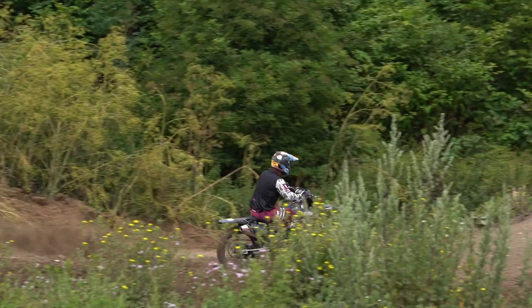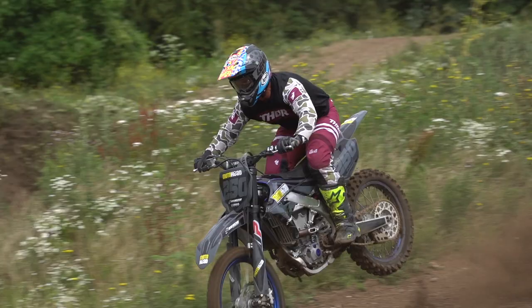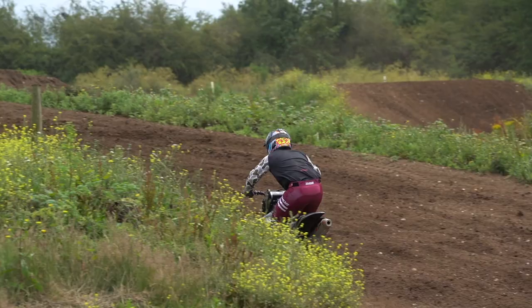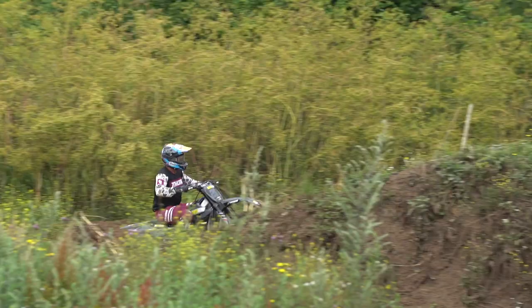On the high speed, from all the way in I backed it out 30 clicks and it just held it nicely in the stroke. On the low speed I was going to both extremes, but I found that winding it all the way in and coming back 13 clicks was the sweet spot — it just allowed the shock to move. On the front forks, it really does allow me on the 450 to be a little bit more aggressive with the front brake and get good front end grip in and out of the turns. Coming off and hitting the transitions the bike was hooking up and driving perfectly, really catapulting me nicely.